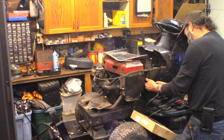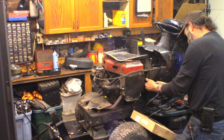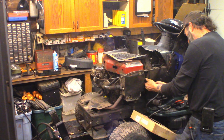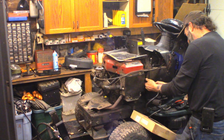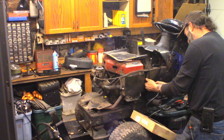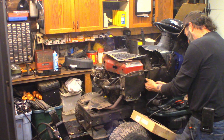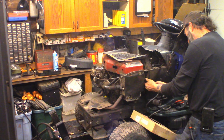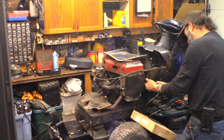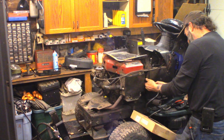Get in your home — trying to force it up over the five-sixteenths part. We just don't have a lot of room here for the filter, but that's in. Nice — and the line is not kinked. It went on top just because it's sitting on the throttle linkage, so let's get it back off and route it over and under and around, back into the fuel pump. There we go, that's better. That's more better. Beautiful.